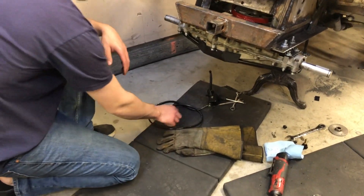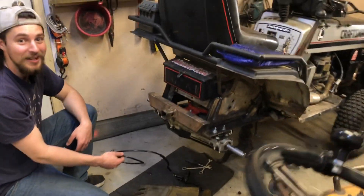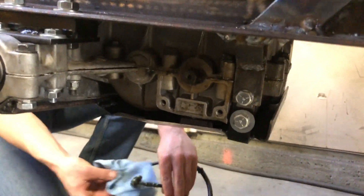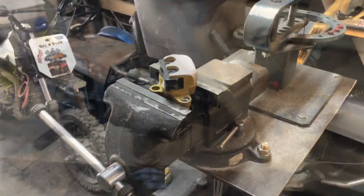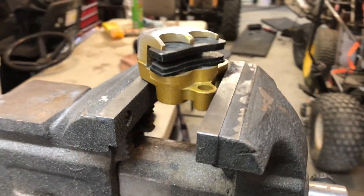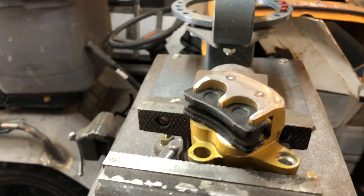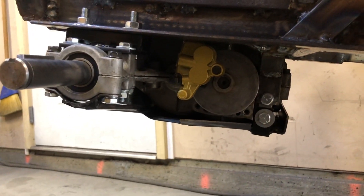Well this is actually a cable for a hydro brake system — which hopefully will work out. The original brake setup is right in here, here's the original disc, and I'll show you guys just what I'm doing right now to modify the caliper to fit in there. You might be able to see lots of grinding happened on the top here — this is just a normal front brake off a 110cc geo quad, brand new, it's a hydro setup like Tony was saying. We got that modified but I had to grind this down to fit in behind the brake disc.